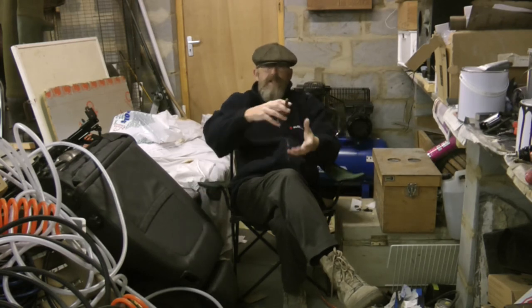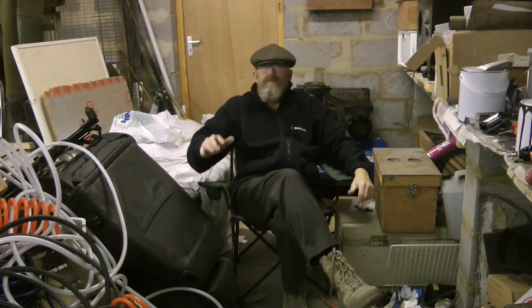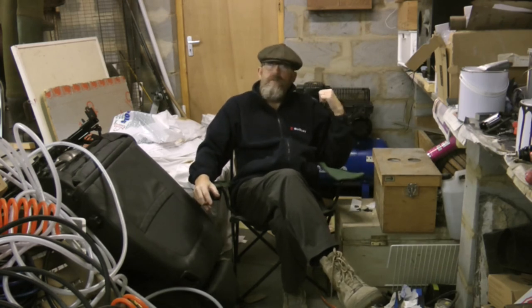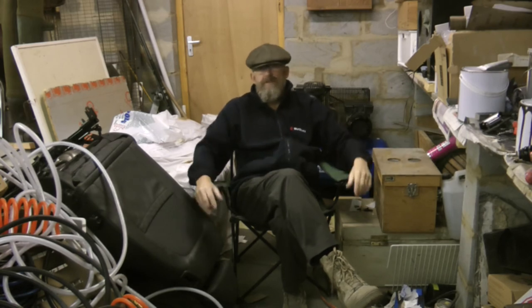And I've got a pressure gauge now on the end of the gun so I can see better what the actual pressure delivery is to the gun. Because I've got a hose run of maybe 20 metres, the pressure that's on the compressor doesn't really bear much relation to what's coming out at the other end, probably. So that makes it quite difficult to finely judge your pressure.